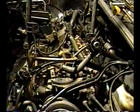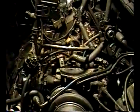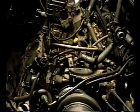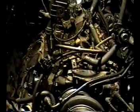And I have to tell you, after all this I've been through, I think I take back something I said earlier on this video, that I was just going to put the regular head bolts back in. Or not back in. Of course, I'd put new ones, but the original intent was just go ahead and put the head bolts, you know, OEM head bolts. I wouldn't put the old ones back in. My intention was not to buy the studs, but after all this work, I'm at the point where I think maybe the best thing to do is to go ahead and either, I can't put studs in while the head's in the car, or while the engine's in the car. You can't do that, but what you can do is you can put inserts in.